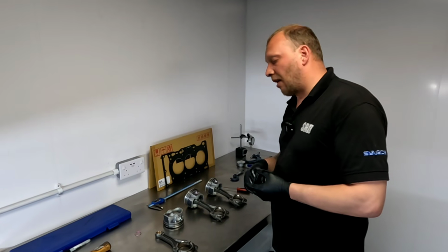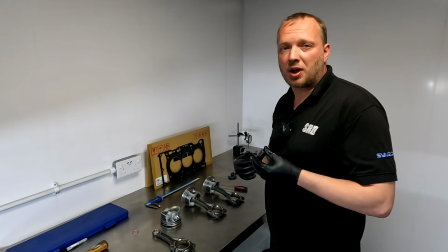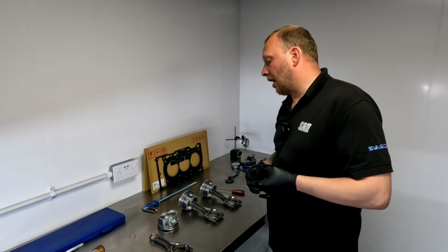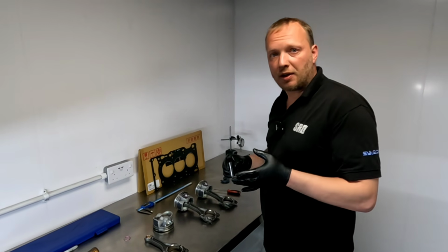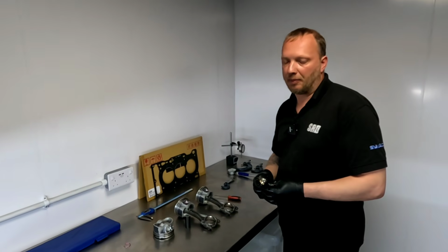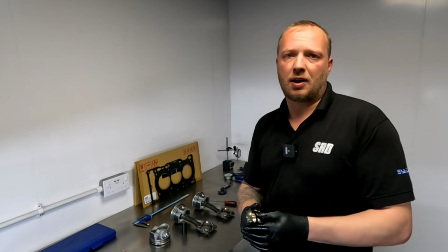So yeah, we'll break out the aftermarket pistons and we'll check the wrist pin thickness and the piston design, and we'll see where Toyota have improved on piston designs over the years, and find the weak links on the engine. So far I'm going to say the little end, from looking at rods over the years. Yeah, let's have a look at the little end.